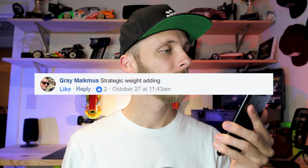even though you won't be able to get much from the setup. Point number 2 would be ride height. Just make sure that your ride height is appropriate. If it's a bumpy track, it needs to be a little bit higher. If it's really smooth and high bite, well, then you can probably lower it a little bit if you want to. But again, play around with it, see what works, check out those setups. I hope that helps.